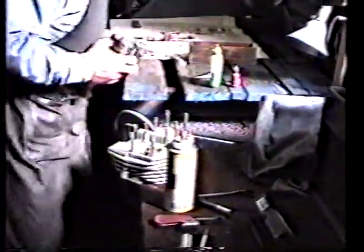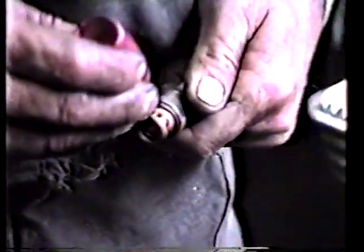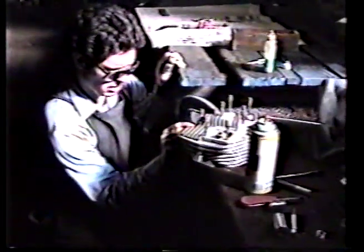What we've found that works the best to put these inserts in is a spark plug with a special washer on it. Always lube the plug, screw the insert on, make sure it goes up against the washer, and square it up. Then take the Loctite — in this case we're using the green stuff, which is by far the best for this kind of high-temp situation. We also put it in here on these threads as well.